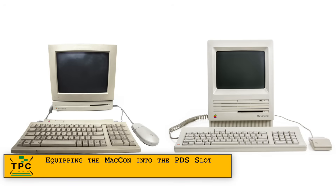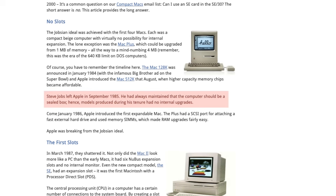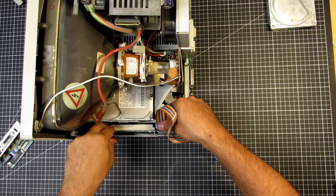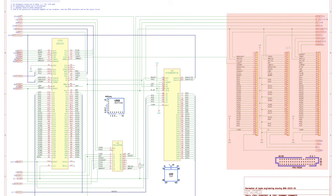Like the Macintosh LC series and the Macintosh SE from 1987, this machine features a so-called Processor Direct Slot, or PDS for short, used to add expansion cards. Had Steve Jobs still been at Apple, this feature probably wouldn't have made the cut — all you'd get would be a sealed box. The PDS isn't a real bus like NuBus or PCI; it taps directly into the CPU. On the SE30, that means a 32-bit data path tied into the 68030 at 16 MHz, giving you around 16 MB per second in theory.